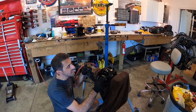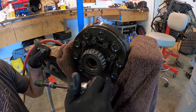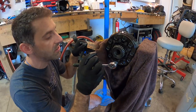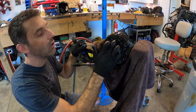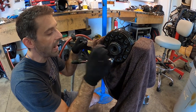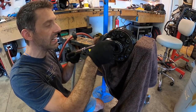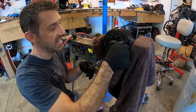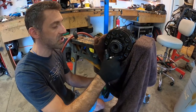We have these eight bolts — I think they're six millimeter bolts — and these have been notorious for stripping, so you have to be really careful removing them, especially if you don't have replacements. I started cleaning these off really well with a terry cloth towel and even used some lacquer thinner to get all the oil out, because lubrication won't bode well for the tool getting into the hole. After taking a look and starting to unscrew them, all these guys came out really, really easy — like they're just spinning. I don't know if that has something to do with the limited slip not working at all — maybe it wasn't tightened enough. These are going to be reusable without a problem.